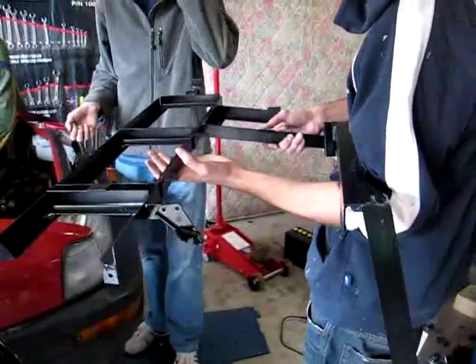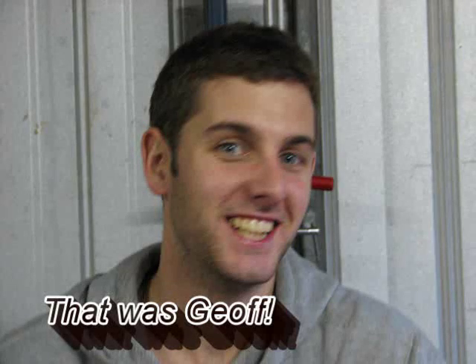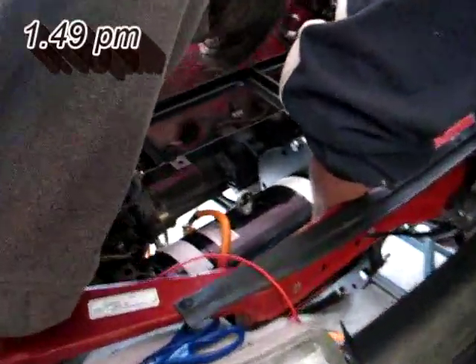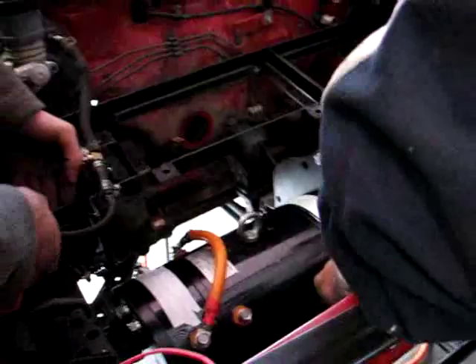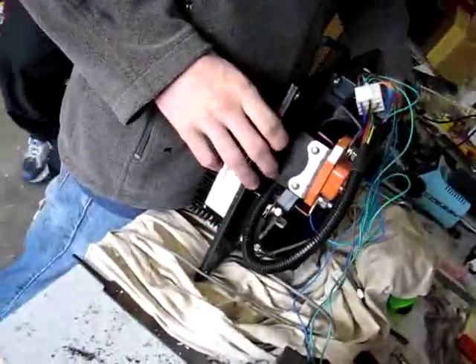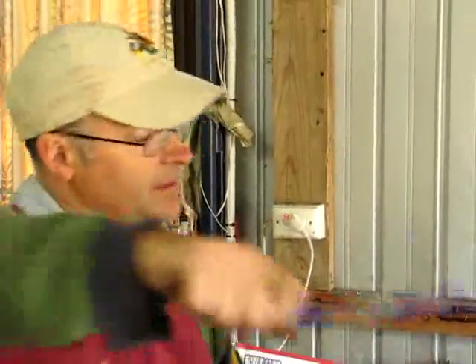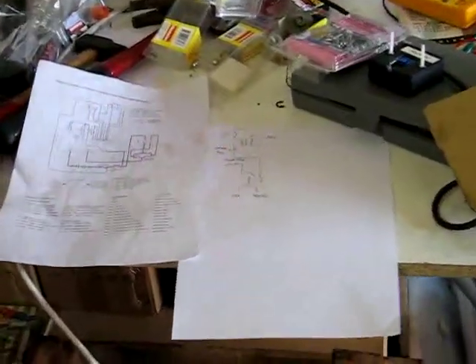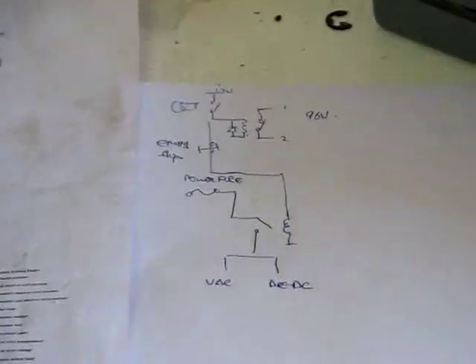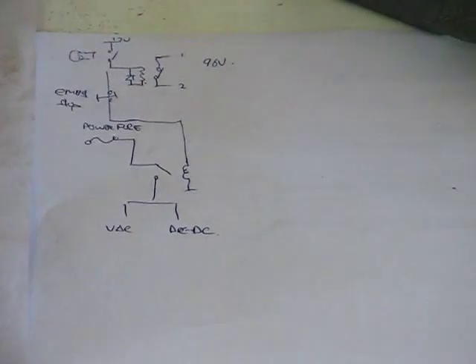I just want to wait until last lunch for this — it's dry but it's a little sticky. We can position it, it'll dry in the bonnet and we can move on. So I'm putting the factory rack back in, just behind the master cylinder. This is the controller plate and we're mounting the DC-to-DC converter on the underside of it, bolting it through. He's traced it inside and got it under the bonnet, so we might need to run a wire back to the switch and out through the firewall — unless we want to track that line inside the car. We must be getting near the end of the project because David's doing wiring diagrams. We've got to the point where we've got to think about mounting relays.